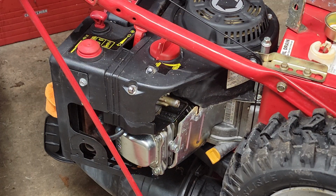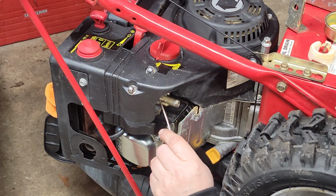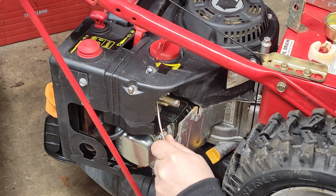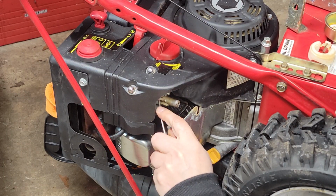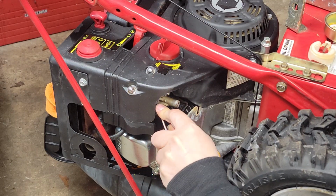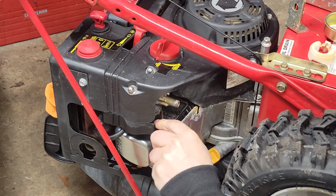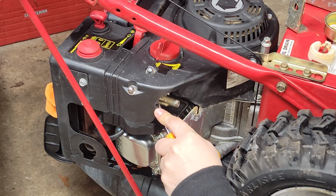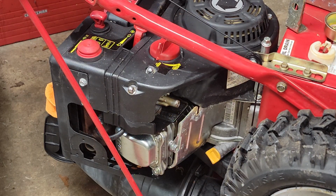You can feel that there's no resistance on that gasket. So when you leave gas sit in these units for an extended period of time, this will happen. Inevitably, you'll develop a leak. You'll have rusty gas, I should say rusty parts inside the carburetor. It's unfortunate. Downside of owning equipment that is not coming out of there very easily.